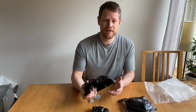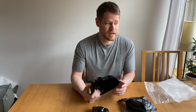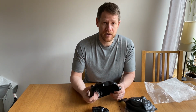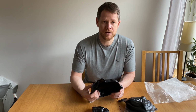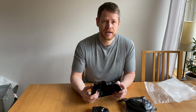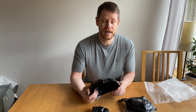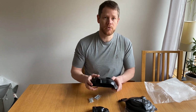I will not film everything when putting it on the bike, but you will see a few shots there, and then when it's on. I actually brought the bike up this morning. It's 6 degrees outside, and I'm going to do some other work as well. I have rear brake pads to replace, and change some stuff with my blinkers, because I had the plus blinker, and I don't want a steady red light in the rear, only the added braking light for the blinkers. Same with the front, I don't want the position light lit all the time. So I'm going to change that, just put 2 wires, that's it. So let's get it on.